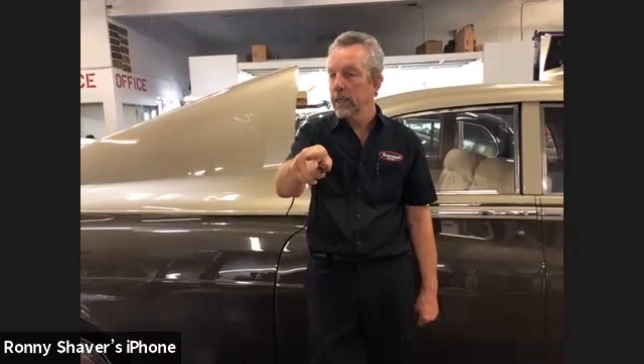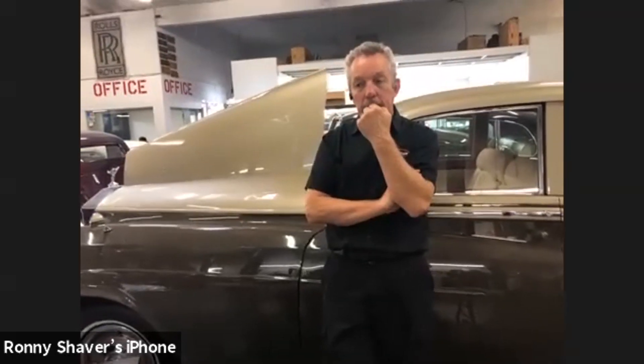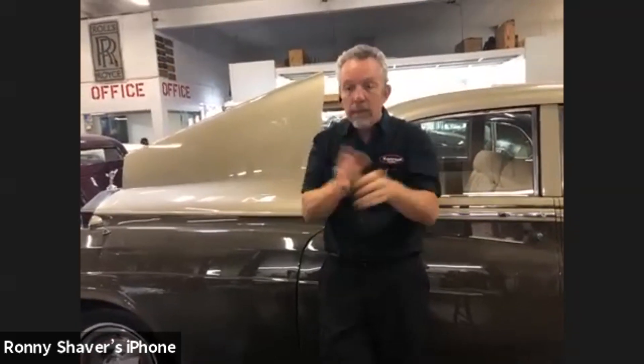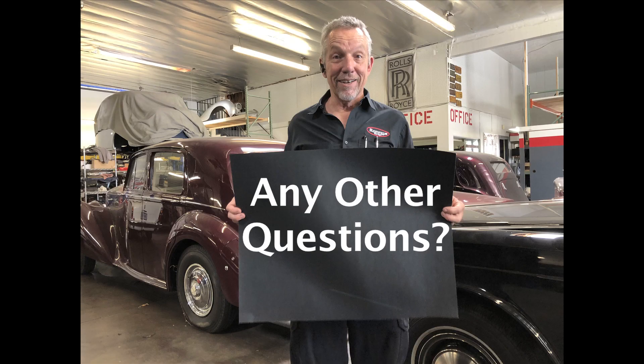On a 69 Shadow, you'll need to check where the reverse lights are located — whether in the trunk or the taillights. Either way, you're going to have to check the wiring in between where the trunk opens and closes, as there's a harness there. A lot of times it's just a loose bulb holder in there — there are just so many things it could be.